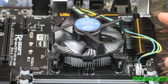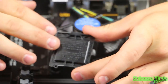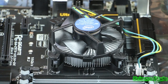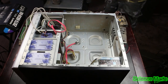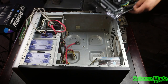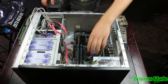You can also put in your RAM and all the other stuff now. I'm going to wait to put my graphics card in until the very last thing — it's nice to have the motherboard in the case before you put the graphics card in. I'm going to go ahead and snap in the I/O connector piece for the motherboard, making sure it goes in the correct way. I'm re-situating some of the mounts so the motherboard fits correctly.